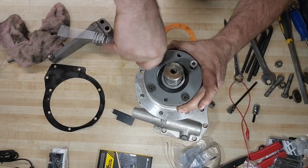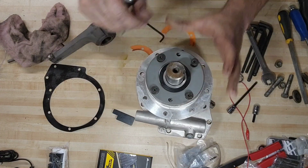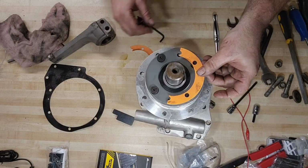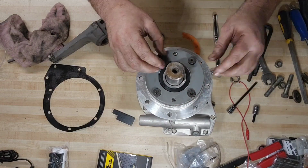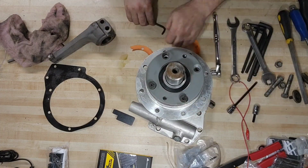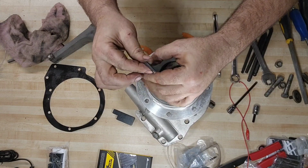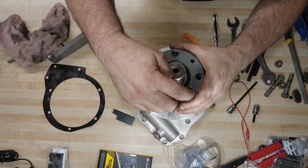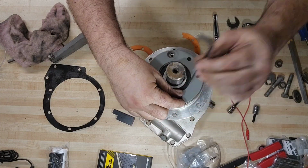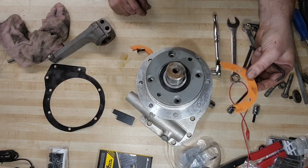You can see how we're going to line them up. Okay, so we bring our shims back in. It's important to line them up properly. I like to put the split or the seam where the press holes line up. So in order to get the shims in there, we have to take the screws back out because they're going to thread through the shims.